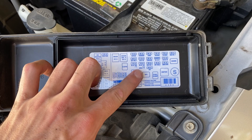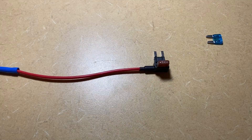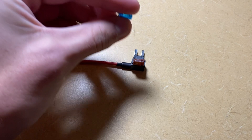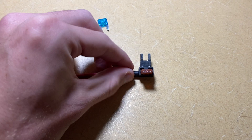It is the 15-amp headlamp left-hand fuse. What that does is give the lights power any time the car is on. Just to provide clarity on that step: when you have your fuse tap, you're going to put the 7.5-amp fuse on the bottom side. Then, when you pull the 15-amp headlight fuse, you use that same fuse and put it on the other side of the fuse tap, which creates a complete circuit. So to reiterate: 7.5-amp fuse included in the package on the bottom, and the fuse you pulled from the fuse box on the top side.